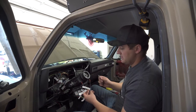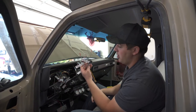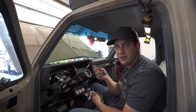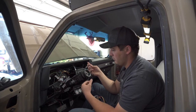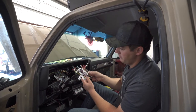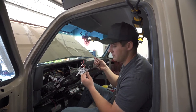Another thing you're going to need to do is make provisions for your program button. These are the little intermittent switches that will control your gauge faces — the little LCD screen on the bottom that tells you your trip meter and all that kind of stuff. On your wiring harness, they're labeled as program buttons. You'll just need to wire this in and make a space. I'm going to put these down by my headlight switch somewhere through my dash. You'll just need to find a nice hidden place where you like them — put them on the bottom of your dash, hide them somewhere nice. They're on both switches — it's just two black wires coming out the bottom. Either one can be ground and either one can be wired into your wire harness. I've got my two put together on a little terminal and I'll just ground this to my sub dash, and the other two wires will get plugged in here on my harness where it's labeled program buttons.